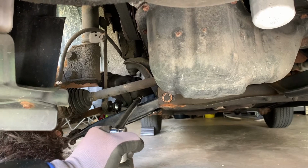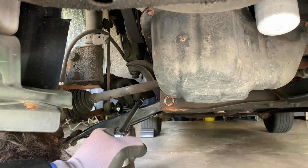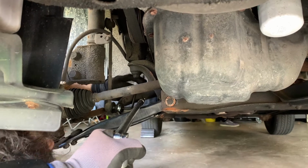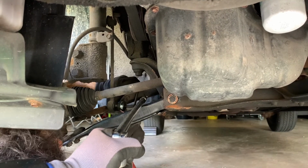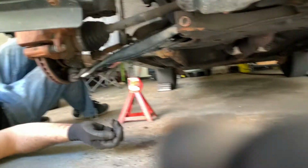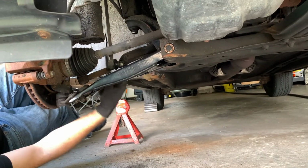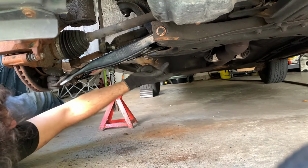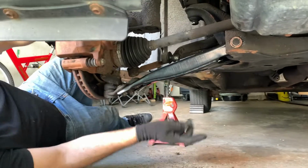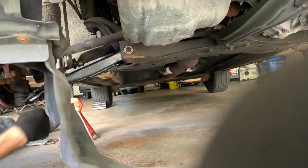Okay. And eventually you can just leave this, as the Allen key will hit the sway bar, and just tighten it up. Okay, so this is all back together. We've torqued these to 66 foot-pounds. We've reattached our sway bar and link, tightened that up. And we've got our two 19mm bolts here and back here, nice and snug. So we're going to get the tire back on, put this up on ramps, and torque each of these bolts to 101 foot-pounds. We'll be right back.